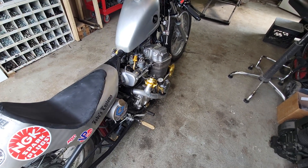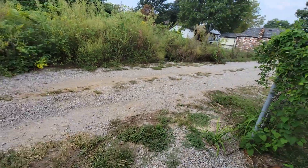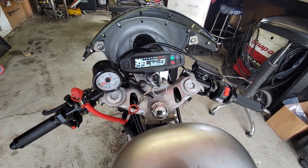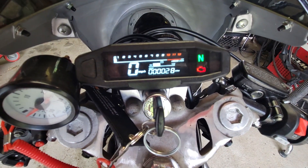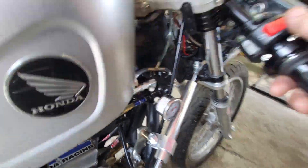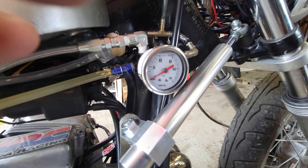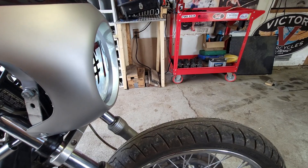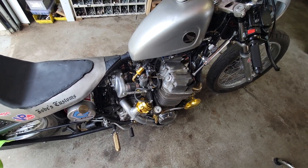So if y'all want to hear it, she's about ready to make some noise. My neighborhood seems all nice and quiet, but I think we're about to wake everybody up. Key on — gauge turns on, the boost gauge is on, but the light does not light up. Come over here, get away from that exhaust. Hit my fuel pressure button — the kill switch now controls the headlight and the fuel pressure so I can turn it off at idle. I'm going to cycle it, get a little bit of fuel pressure. All right, we're good to go.